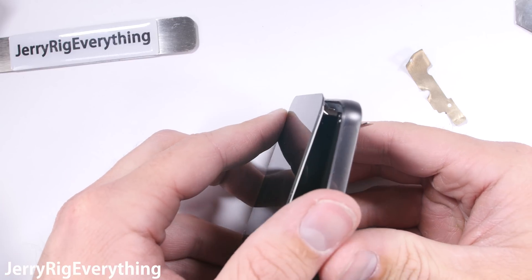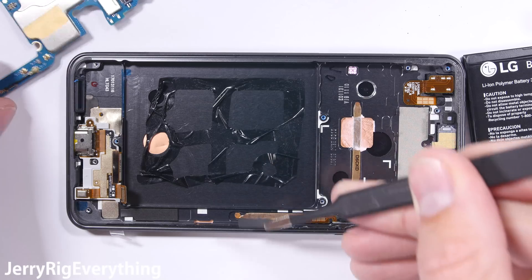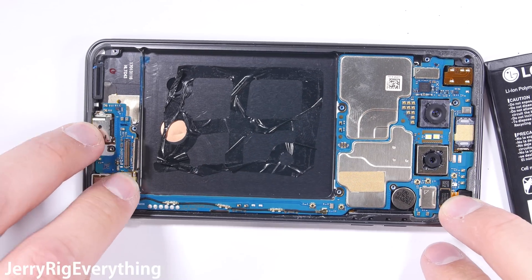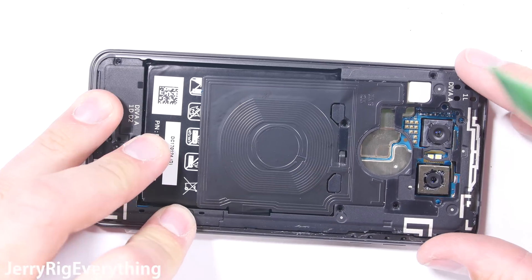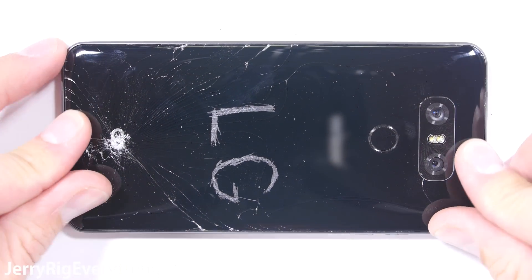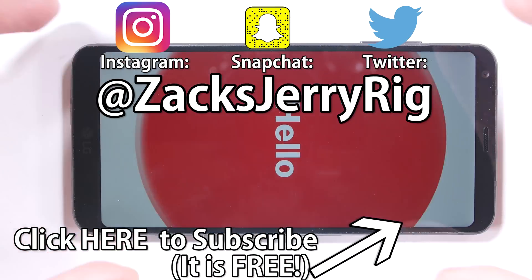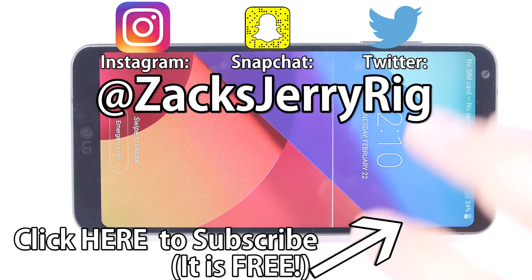Assembling the phone is easy enough — just pop the LCD back into the slot. A new LCD would come with additional adhesive, but I'm just going to reuse the old one. After the LCD is in place, I can get the charging port back in. The motherboard is tucked underneath the ribbon cables, then I can snap everything back into place like little Legos, including the new battery. The back black plastic clicks in as well, and the 11 Phillips head screws hold it all in place. Huge thank you to LG for letting me borrow their phone. I'm looking forward to using this phone in real life. If you enjoyed this video and want to see more like it, hit that subscribe button and turn on your notifications.